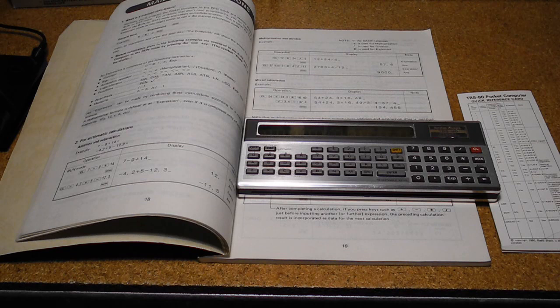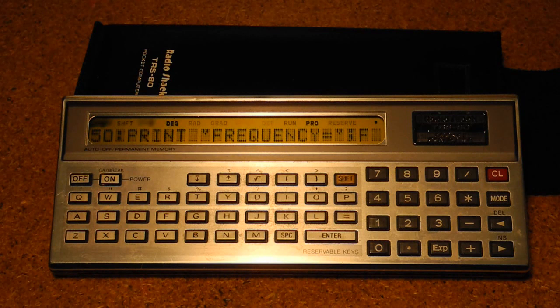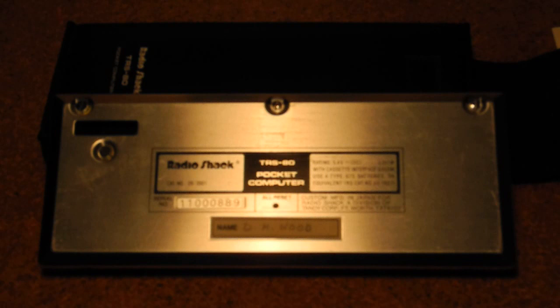The calculator internally has two 4-bit CPUs, one acting as the main CPU and the other managing input-output and the display. It has 1.5 kilobytes of RAM and a BASIC interpreter in ROM. The display is a 24-character by one-line alphanumeric LCD, and it has calculator-type keys with QWERTY layout alphanumeric keys. The memory supports BASIC programs with up to 1,424 steps, with 26 variables named A-Z, or A-Z$ for strings, and another 178 variables shared with program memory. Calculations can display numbers in scientific format with a 10-digit mantissa and 2-digit exponent. Battery life is around 300 hours using four 1.35-volt button cells, and the batteries back up the internal memory. It has an integrated beeper and a connector for the optional printer and/or cassette tape.